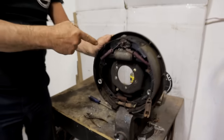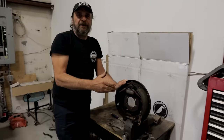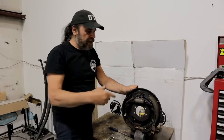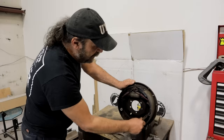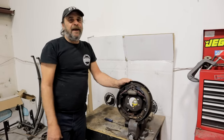And it's that easy - that's it. It should take you on average less than 5 minutes to do an R&R. Obviously if you're replacing all kinds of stuff, but if it's just a quick R&R to change the shoes it takes about 5 minutes total. Quick and easy drum brake R&R - I hope you got something out of that, I'll see you tomorrow.